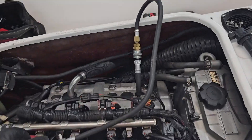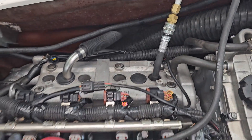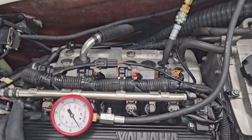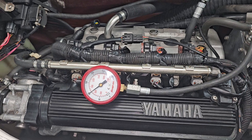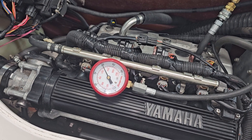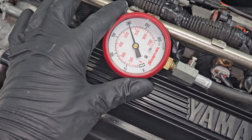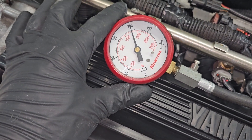With our plug read having the rear cylinders showing the best-looking plug — it looked perfect — I'm going to guess 205. I should have gone with my gut; I was going to guess 200, which would have been closer. So 200 minus 8 gives us 192.